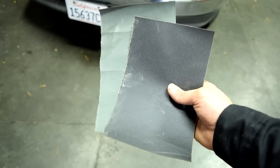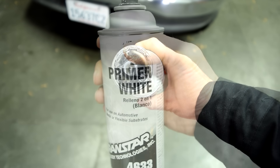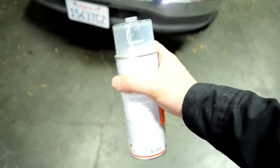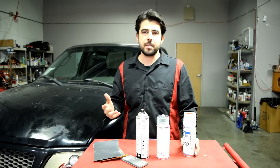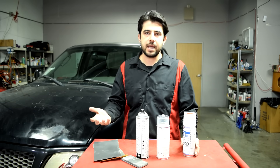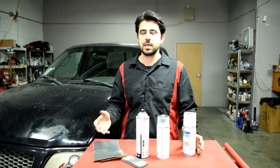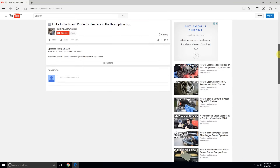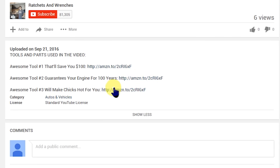In order to perform this repair, you'll need a couple of different grits of sandpaper, a sanding block, some primer, some color match urethane base coat inside a can, and last but not least, some 2K clear coat. There might be a couple of other things like masking tape. I'll put links to where you can buy them cheap down in the description box.